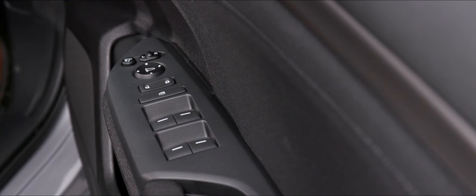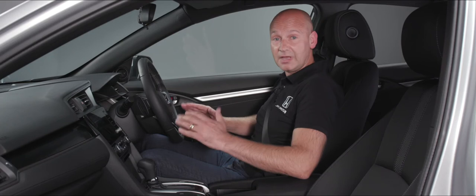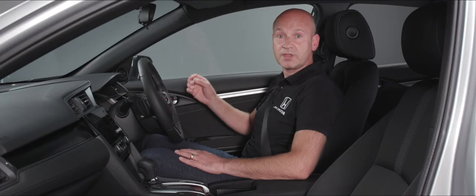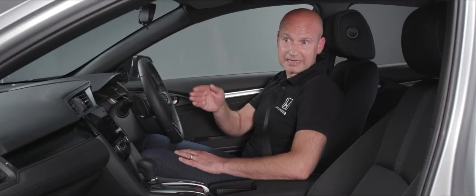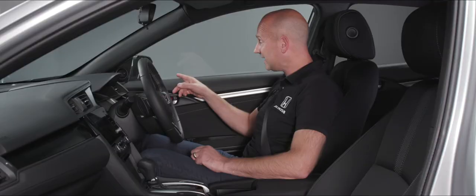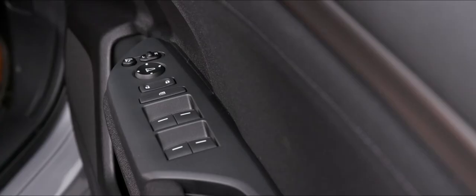On the right-hand side for the driver, just in front of their armrest, we have some control buttons. Right at the top is the button which will electronically fold in the door mirrors and fold them back out again. When it comes to adjusting the angle of the mirrors, inside the door mirror controls we have a little selector switch — slide it to the left to adjust the left-hand mirror using the four-way pad underneath it, slide it over to the right to adjust the driver's mirror. Once both are set, slide the selector back to the middle position.